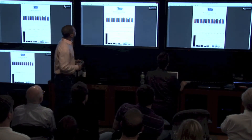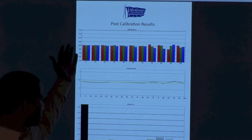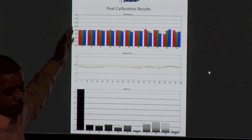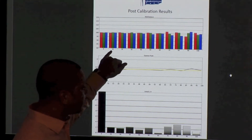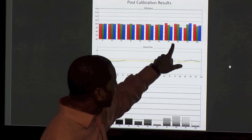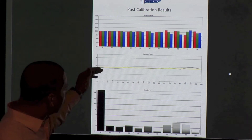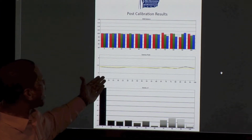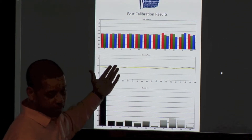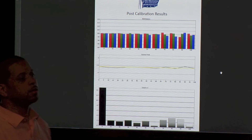The resolution is high now. This is the Samsung — the F8500. This is the grayscale tracking. Forget zero, that's irrelevant; especially in this Calman software, it does not even attempt to measure this correctly, so it just makes it equal. You can see the points of the 10-point where we had issues — starting at 70 to 100, that's where the 10-point controls just basically died on us. Gamma is relatively flat; it's not as flat as I'd prefer. We're still splitting hairs — with normal content you really could not see this difference. They're around 2.4 average.